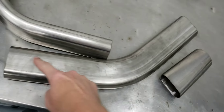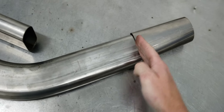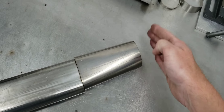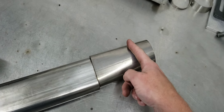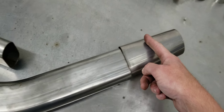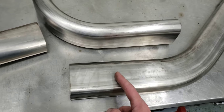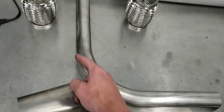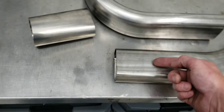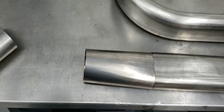I've got a 45-degree bend — this will be the majority of the down pipe. I have this round transition; of course this will all get shortened up so it'll attach to the stock header here. I'll have the first O2 sensor probably somewhere here — that'll be the factory wideband — then a merge or transition down to the oval for the bend. This will go underneath the transmission support, and I bought this mandrel-bent oval to be able to wiggle around if I need to. This will essentially flow back and merge to two-and-a-half inch round, and then I'll create the two-and-a-half inch merge.